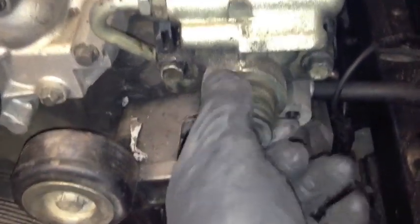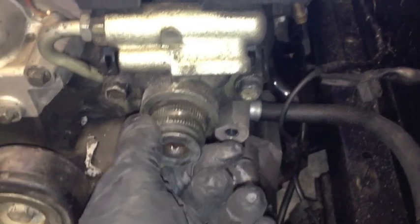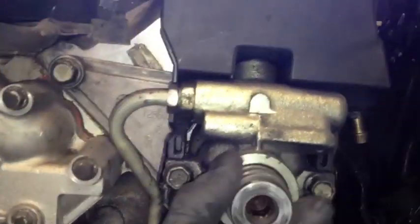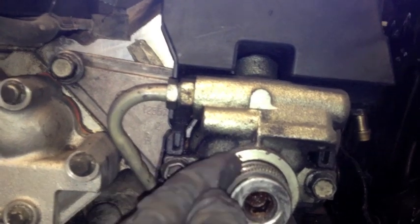Had a tragedy with the power steering pump. I was gonna make you guys a big how-to video, and then I figured I'd practice. And anyhow, this is kind of the remains. I was trying to use that GTO pump, and it wasn't working. I guess the pulleys are different, completely different. But it started to go on there, and it seemed like it was going to finish going on there. So I started hammering it, and the damn thing cracked these guys right here, and I cracked it pretty good, right down the half. I was going to try and JB Weld it, because I can't find nothing. Anyhow, I don't have power steering no more.